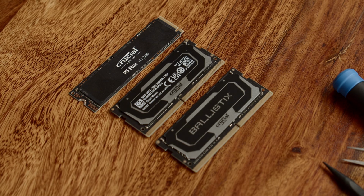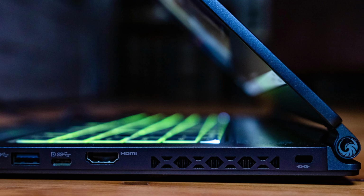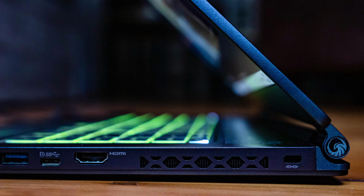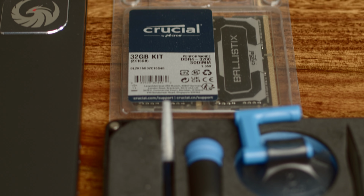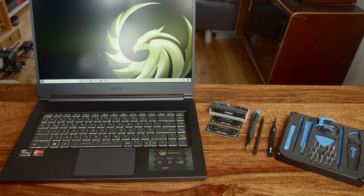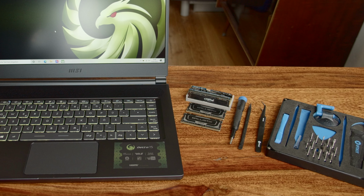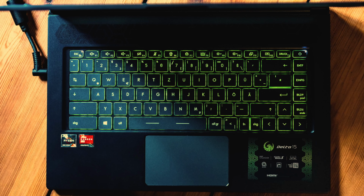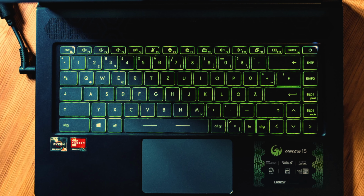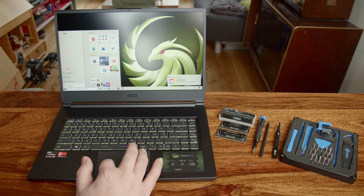Our model comes with 16 GB of RAM and 1 TB of NVMe SSD space. So naturally, we want to go a step further and replace the RAM with 32 GB of Crucial Ballistix, as well as an additional 2 TB Crucial P5 Plus NVMe drive. Because we like to flex. So if you wondered, yes, there is a second M.2 2280 slot available. I'll leave some links down in the description with the specific parts we used for this video. Okay, so let's start our little operation.